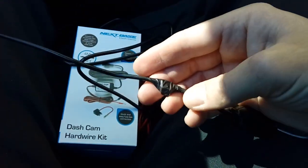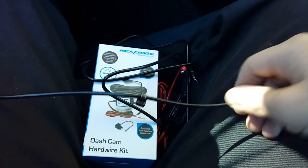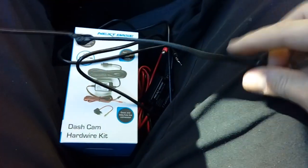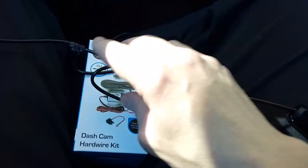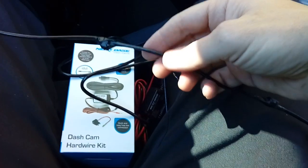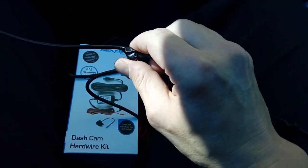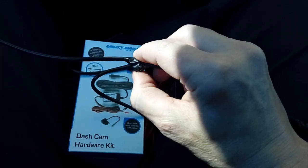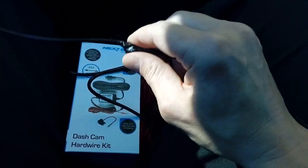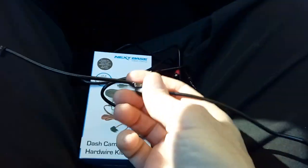What I normally do is get three cable ties, wrap them around the cable, snip them off, and cover them in some electrical tape. This is to bulk the wire up so it doesn't fall down from the top of the windscreen if you hit a big pothole. I cover them in tape because cut cable ties have quite sharp edges and you don't want them wearing away at the inside of your headlining when jigging around.